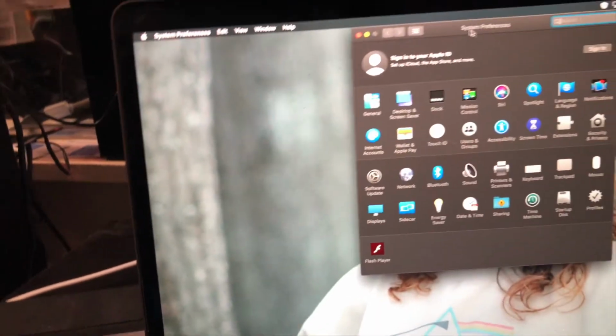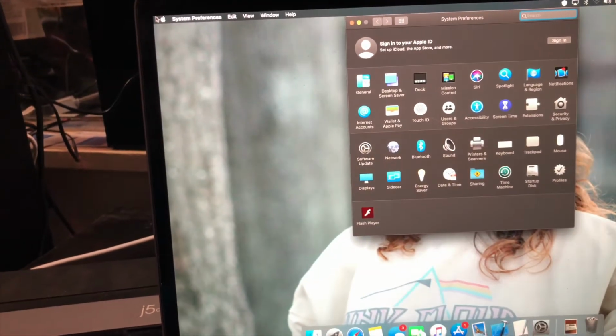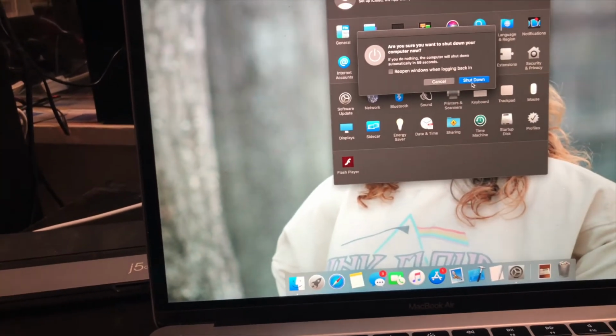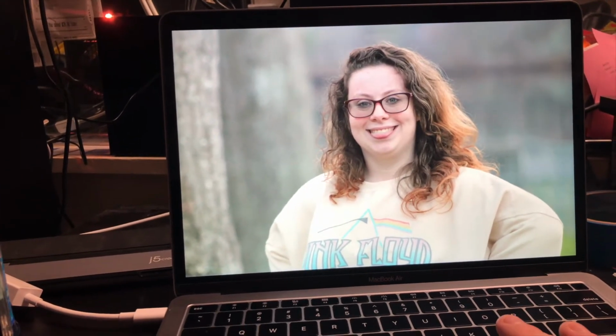Hey guys, so in editing this video, I just discovered that I never actually told you guys to go into settings and sign out of iCloud. So do that. Now that we can see that we're signed out of our Apple ID, we're just going to shut down this MacBook completely. We're going to click shut down. Doesn't matter if we click reopen because it's not going to boot back up to this drive.